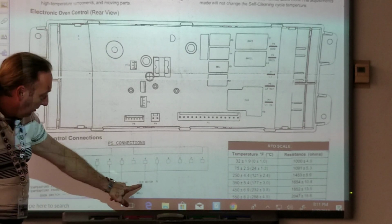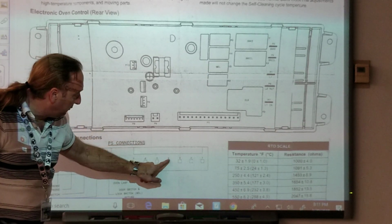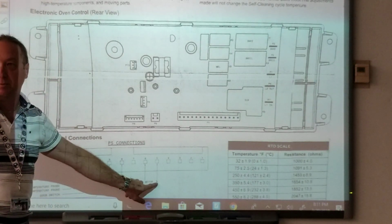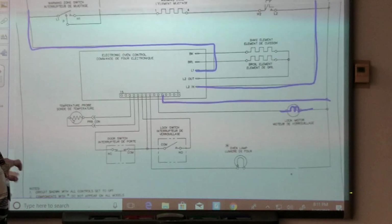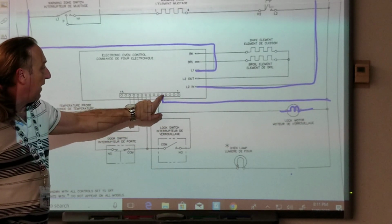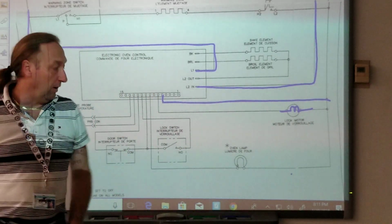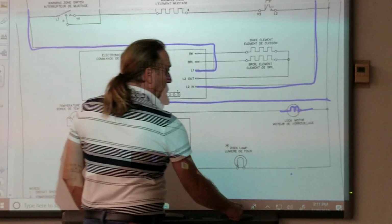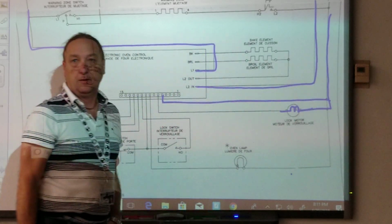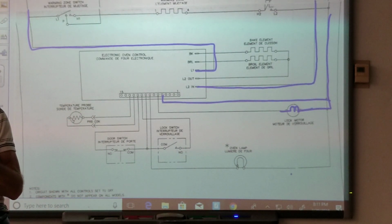And if we look here, lock motor, and then that one pin, 1, 2, 3, 4, 5, is the neutral wire. I know it's a little hard to see, but that's neutral. So if we went back to this diagram and went 1, 2, 3, 4, 5, that is my neutral line coming in. So if I knew that this was neutral, here, it also goes to my motor. If I'm gonna put neutral to it, the motor can't be 240 volts.